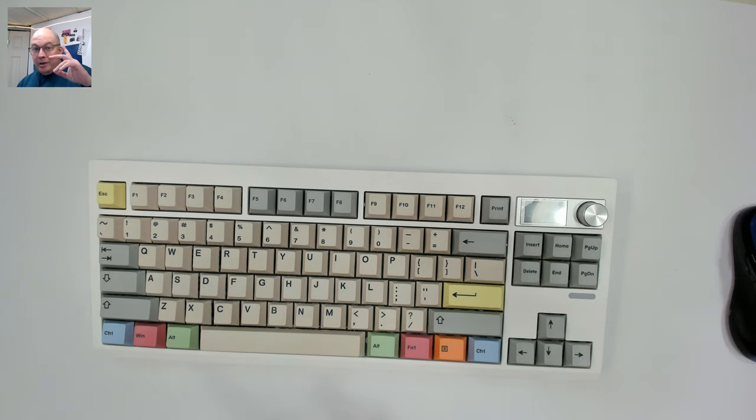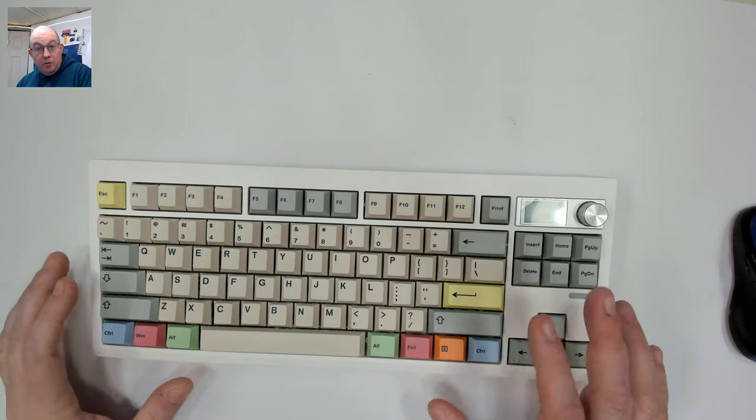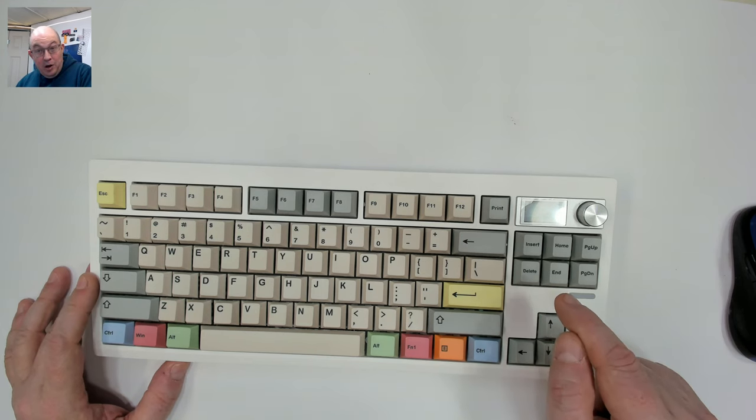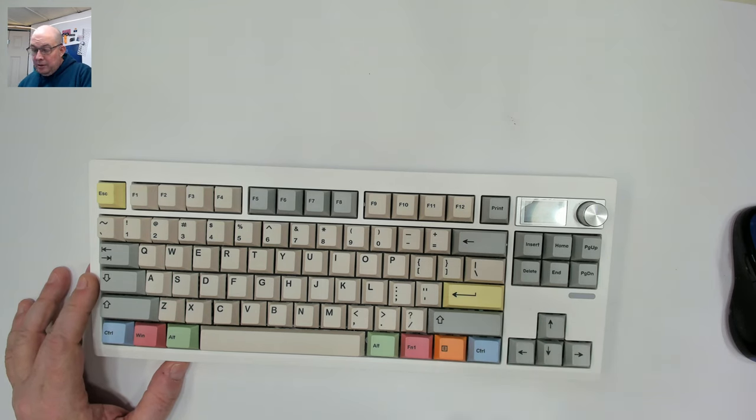And even though there's a brightness control in the lighting column in Via, that won't work with this one for the brightness of the key LEDs. But if you select a key that you want to be brightness plus or minus, you map it to that Any key, and when the window pops up with a drop down, you've got to search all the way down, and there'll be Brightness Plus, Brightness Minus, RGB_VAI, RGB_VAD. One's for up, one's for down, and you can map it to those.